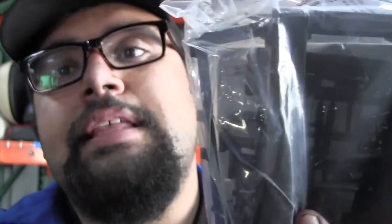So the adapter kit that I got, literally off Amazon. This one's specific for GM vehicles. There are very universal ones out there, but if you could find one for your make, it makes it a lot easier. They tend to be a little bit better fit and finish. Basically, there's gonna be a lot of adapters in here. There's gonna be tabs I might have to rip off here and there, whatever the case is. So you just gotta find your vehicle in the list of vehicles in here and you'll be fine. If you search on Amazon or eBay your vehicle and then stereo install kit, you'll find one of these very easily.